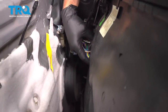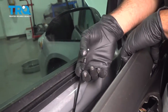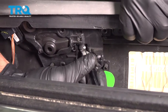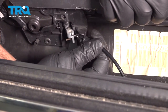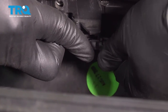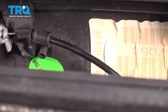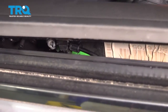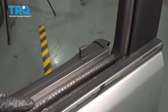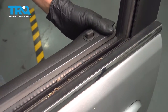Once that's locked in, bring your door panel up. Feed the harness up and into that area. On the inside, we have the cable unit — line this up and install the cable on the back side of the handle and get that popped into place. Now hang the top of the door panel on the sill, line up the door lock, make sure the door panel sets properly, and then snap it into place.